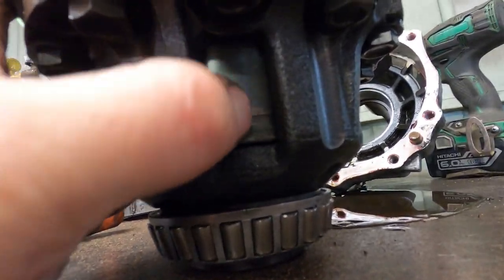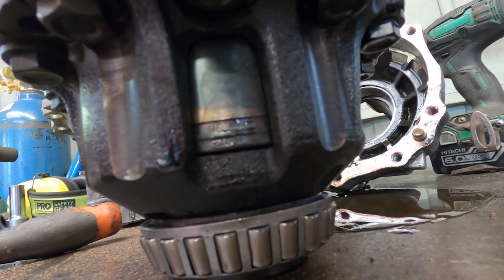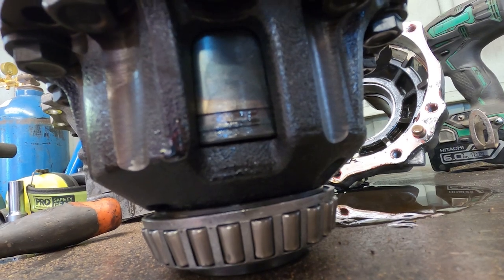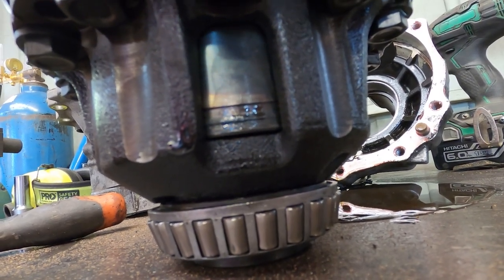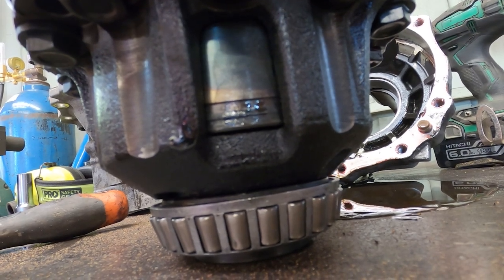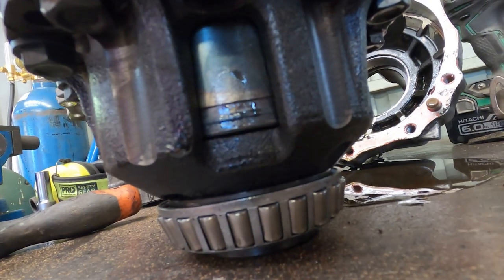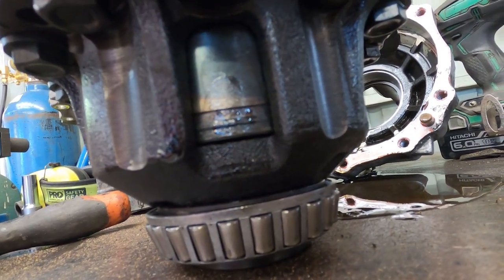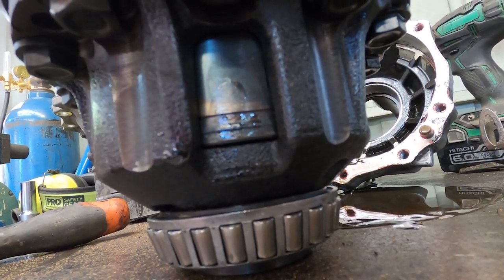we've got the viscous coupler in there, which is pretty good for a standard machine. I'm running the Dodson front LSD, which effectively deletes the center diff, so it's just a solid drive, renders the viscous unit obsolete, so it's just there kicking around for the ride. Weighs, I don't know, 5 kilos or something, so we'll whip that out before we put it back together.